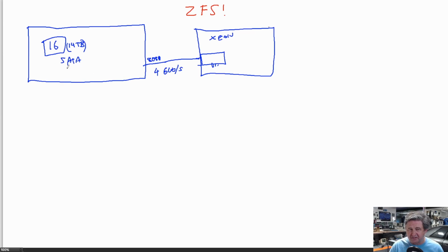First, we're going to try putting all 16 drives in one gigantic RAID0, just a span of RAID0. They're all individual vdevs, which is of course the best for performance, but there's no redundancy. We're then going to move over and do mirror sets, where every drive is paired with a second drive, so there are little mirror sets of 2 drives.